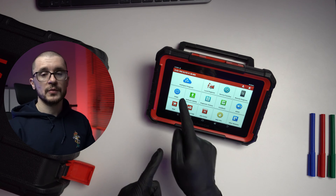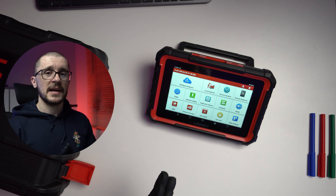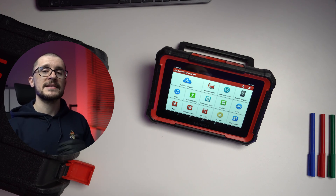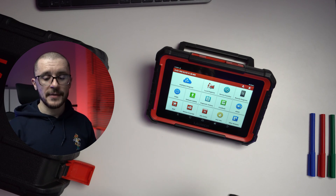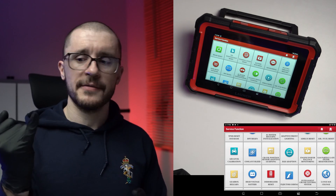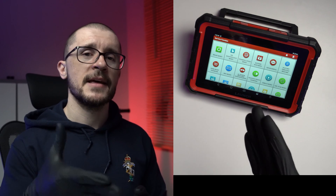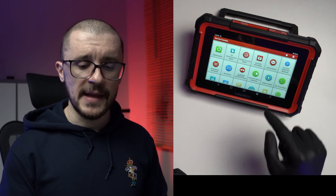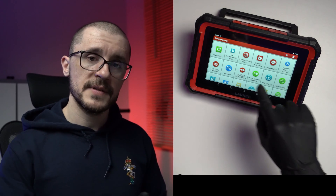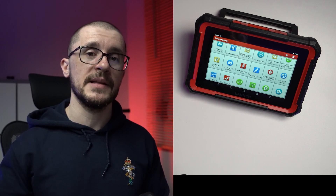Intelligent diagnose and local diagnose — one is faster, the other is slower, although I've noticed both are as effective as each other. All sorts of special servicing functions are available: DPF regens, DPF monitoring, AdBlue resets, electronic parking brake resets, service interval resets, you name it — they have it. Of course, all of this is specific to the capability of the vehicle.